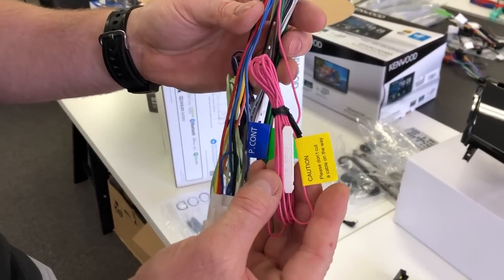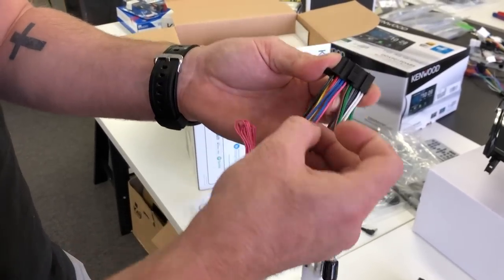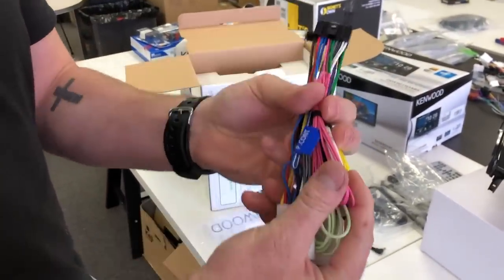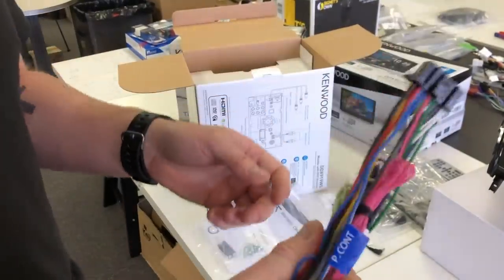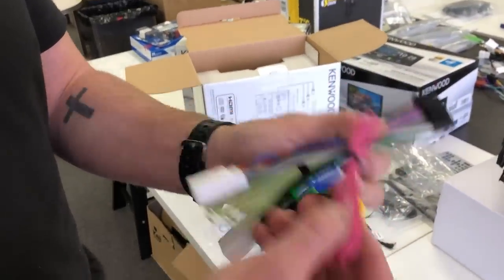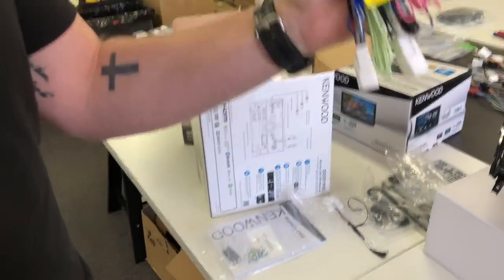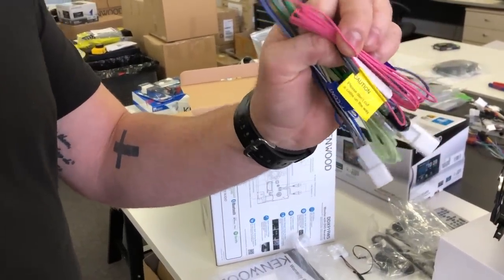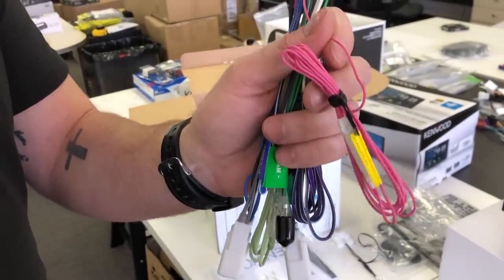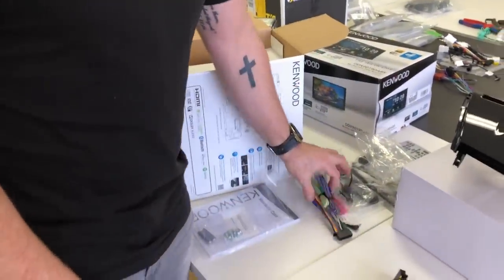Here's the new addition this year — this is the VSS wire, the new pink wire. VSS stands for Vehicle Speed Sense, and it's five pins in right next to the blue antenna wire. It's very important that you hook that up to the Vehicle Speed Sense wire because Apple CarPlay needs to know on the wireless system how fast your car is going, to give you accurate representation on navigation. It's a hard wire to find on certain vehicles. There's also a caution not to cut the cable as it often goes to your ECU — damaging it could damage the car.